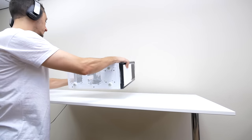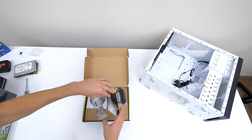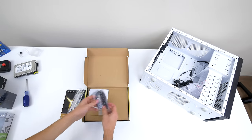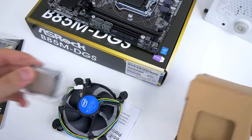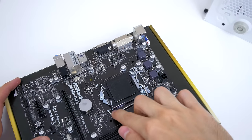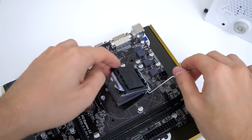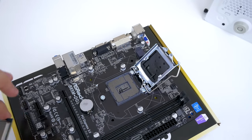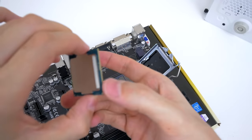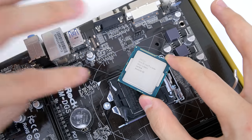Alright, so step one is to lay your PC sideways with the side panel off, open up your motherboard box, and remove the motherboard, I/O shield, and SATA cables. First thing we're going to install is the CPU, so remove that from the box and pop open the socket cover on the motherboard by pressing down on the lever and pulling it away from the hook. Whatever you do, do not touch the center of the CPU; instead, grab it carefully from the sides. Make sure to match the gold triangle of the CPU to the triangle located on the socket cover